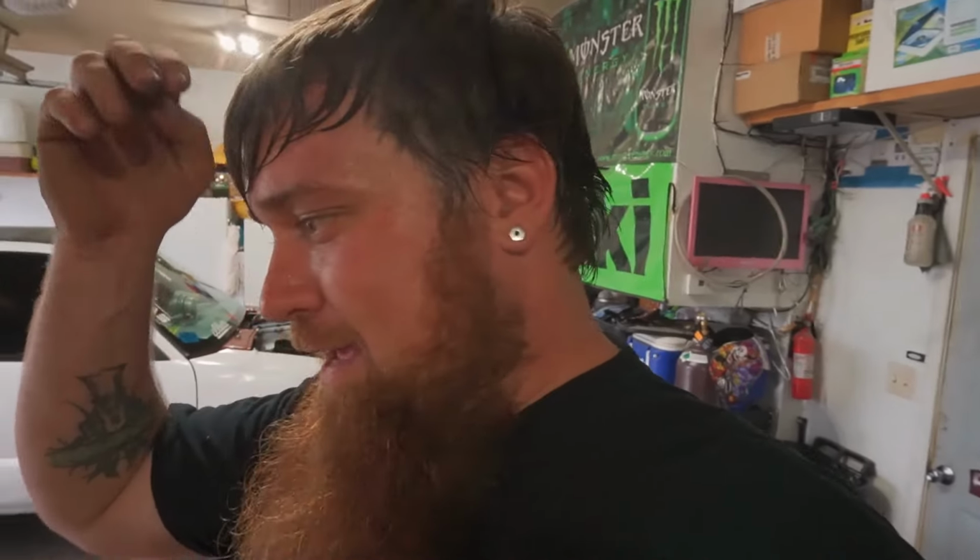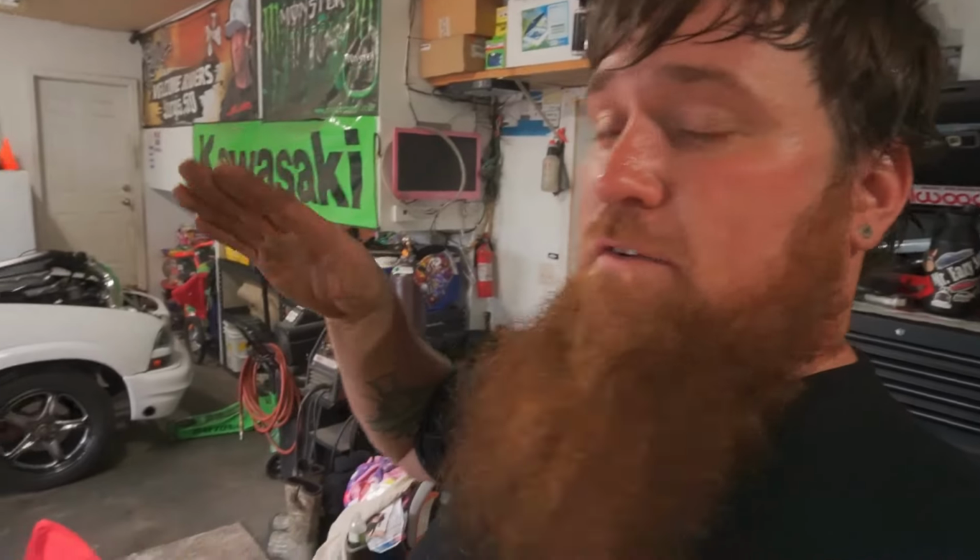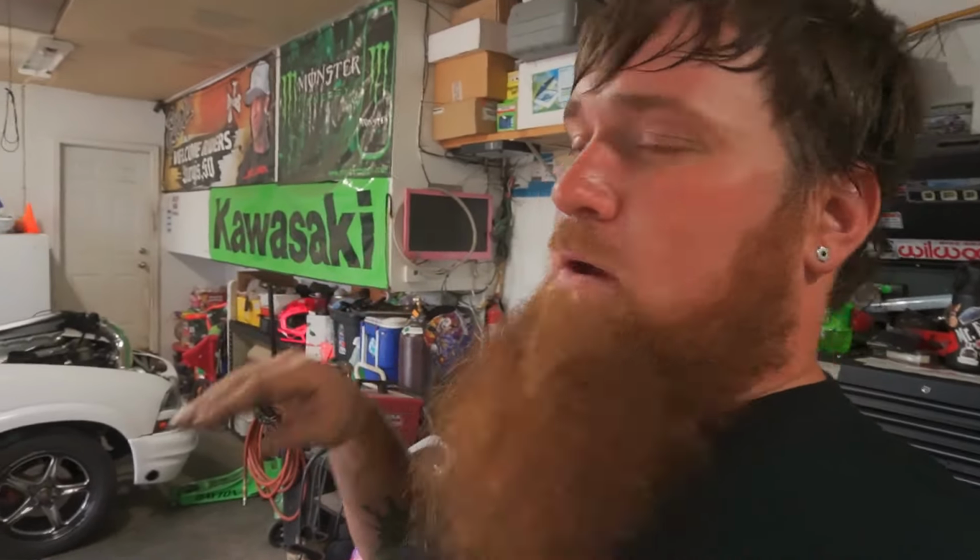I think I'm just gonna chop it up to, this is going to be the best that the truck is ever going to be. Yeah, kind of sucks. It makes me really think that the frame definitely is bent. This thing will launch, and they call it the G-body shuffle. A lot of people don't know that S10s are G-bodies, essentially. I actually have G-body dirt track front control arms on this thing, so it's pretty much a G-body on a truck chassis, well, truck body. And this thing will do the G-body shuffle. I'll lift the driver tire up and I'll carry it about 100 foot with it just barely off the ground, and the front tire won't even spin at times. And I think we're just gonna chop it up as the frame being bent.